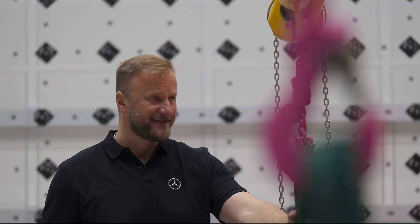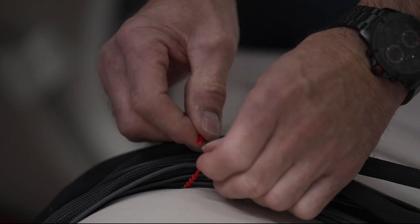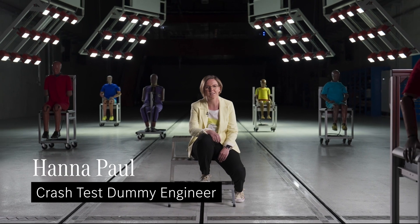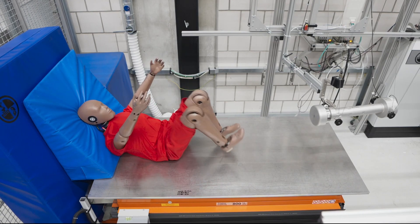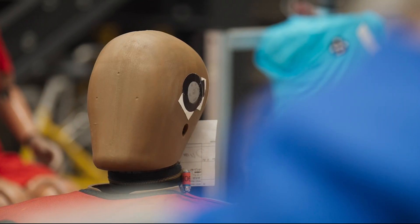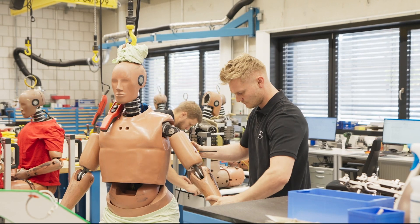When the car is painted, we place measuring instruments and a lot of technical equipment into the car to make sure that all the signals from the dummies are all coming together. Dummies are a measuring device used to evaluate the safety of our cars. There are up to 150 sensors inside those dummies. The sensors measure different forces, different accelerations, and compressions. Those measurements are directly linked to possibilities of injuries. One of the most important things is that the dummy is working properly — the kinematics are correct, the sensors are measuring properly — and then we have to make sure that the dummies are positioned correctly in the car.